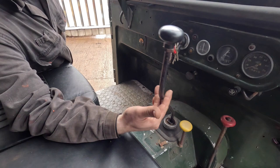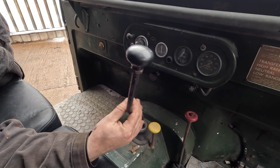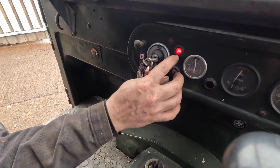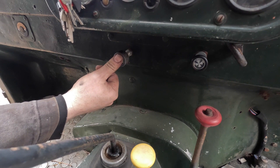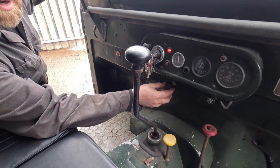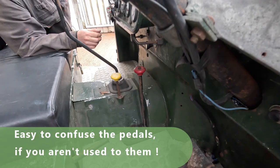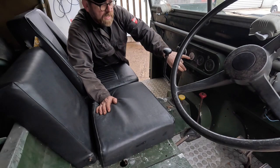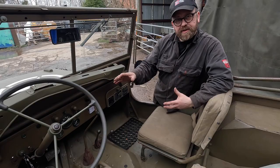The starting sequence on the Series 1: make sure the gear stick is in neutral - it's quite a sloppy box, so even when it appears to be in gear there's slight movement, so you really need to wiggle the gear stick to confirm neutral. Insert the key and turn it to the right - you'll see the gauges jump as electricity is applied. Then press the starter button down here and it should start. Ollie is going to press down on the accelerator to give a little gas while the button is pressed. There we go - the petrol gauge is up and the charge rate has come up. That was starting the Series 1 Land Rover.